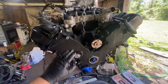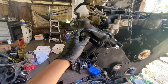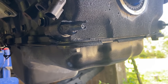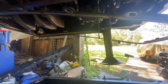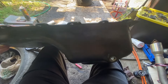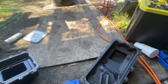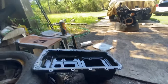If this is your first time doing a motor swap, the first two on the list are probably a little bit scary, but they're actually not that hard to do at all. Your oil pan is going to be 16 bolts, all the same length, so you don't have to keep them in order. Drop those out and take the pan off. This is a good time to do your oil pan gasket — it's pretty much impossible to change it later, and if it leaks you're going to hate life. Once you have your oil pan off, you'll notice the Mustang oil pan is smaller than the Crown Vic oil pan. You want to use the Mustang oil pan and oil pickup because the Crown Vic oil pan will hit the Mustang K-member and will not work — trying to jam it in will damage it, choke the motor, and kill it.